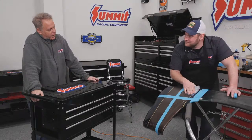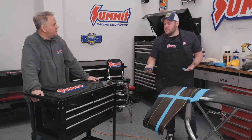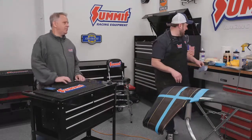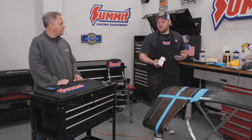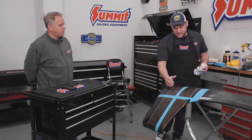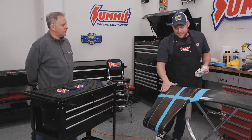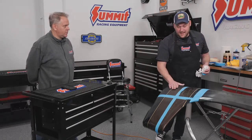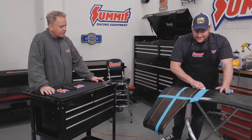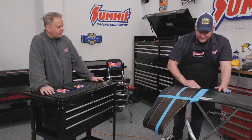So what is a pretty common mistake you see people making at this stage of the game? At this stage, runs are bad. Fortunately, we don't have any runs in this. But runs are always bad. It's a very fine line to sanding them out, because when it runs, it actually will sag the paint. So you'll see the paint sag here and then have your run. You have to sand out the runs and then try to get the sag out without going through a layer of clear. Hopefully you can do that. If not, you're going to be using 400 grit, sanding it, blending in that spot and going from there.